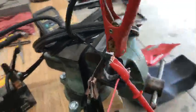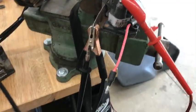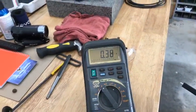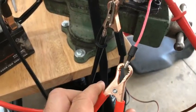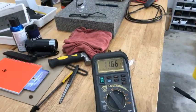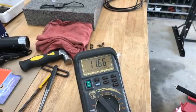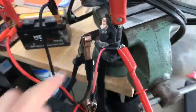This little terminal is the one that gets the low-amperage power from your starter switch. So what we're going to do is simulate: from this battery cable we're going to put 12 volts to this. Now, this terminal - the one we're trying to make contact on in the solenoid - has battery voltage at it. That should be zero, and before I cleaned it, it was zero. Going ahead and energizing it: I've got 11.6 volts. Testing the other side: 11.68 volts. Testing the battery under load: no volt drop - that's fantastic. On the solenoid coil low-amperage side, I got a tenth of a volt drop.